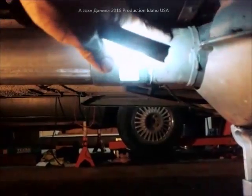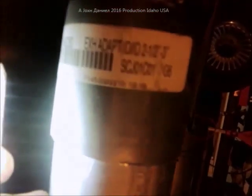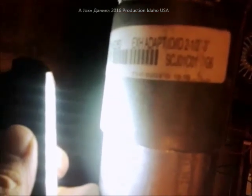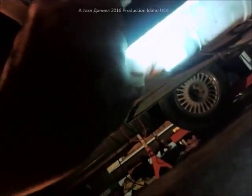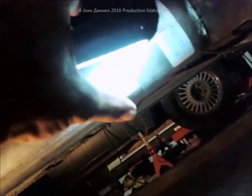It's the perfect size to fit up inside because this is an odd size - actually about two-and-three-quarter inch pipe. This adapter fitting number SCJ01C01 is the one you're going to use. It will hammer right up inside of here. You remove your old clamp, cut it away, and hammer it up in there. It doesn't reduce your flow because you were already going into a two-and-a-half inch reduction, and now you've still got two-and-a-half inches going immediately into three inch.